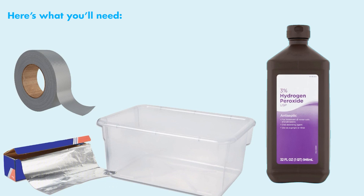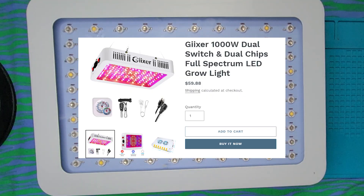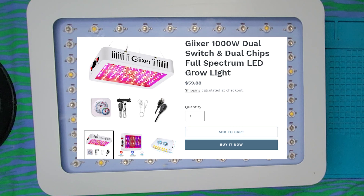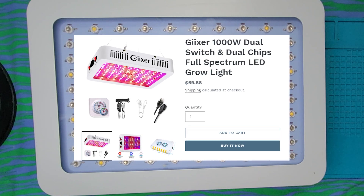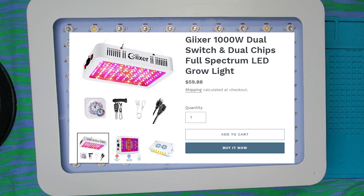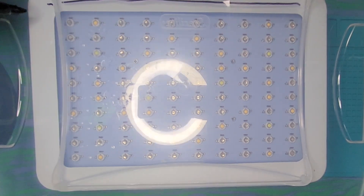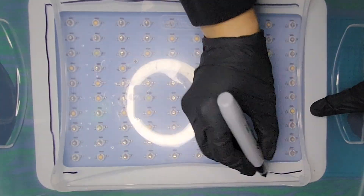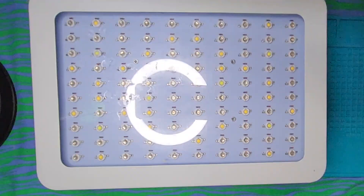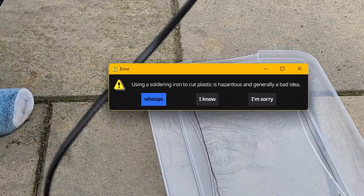Finally, you're going to need a UV light source. This is the particular light I use. I use it because it has internal fans that stop the time machine soup, so to speak, inside the chamber from overheating the parts and melting the plastic. I cut a hole in my lid to hold the light, but you can just suspend your light above the chamber. I only do this so there's not too much light leak in the room that I do my retrobriting in.